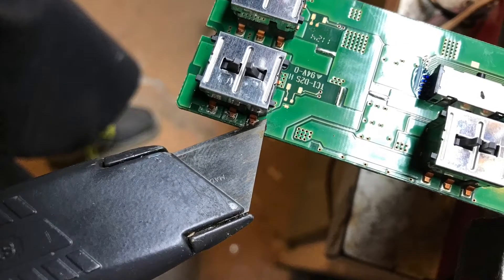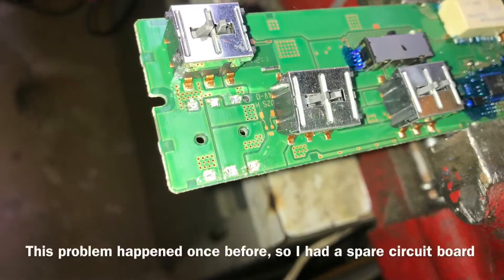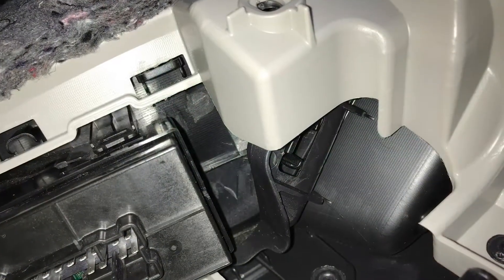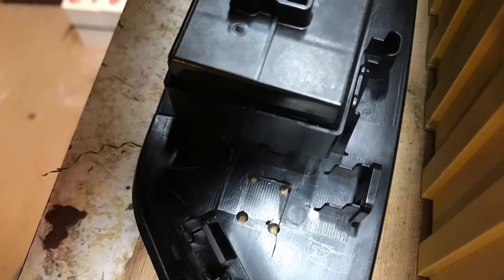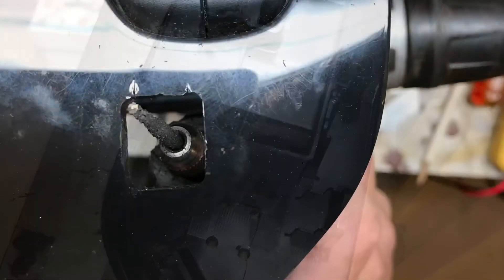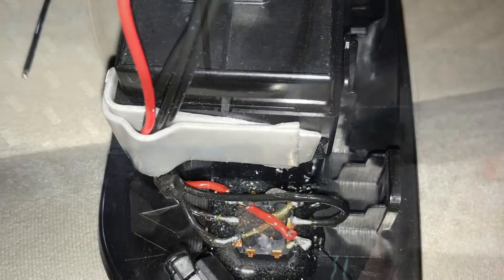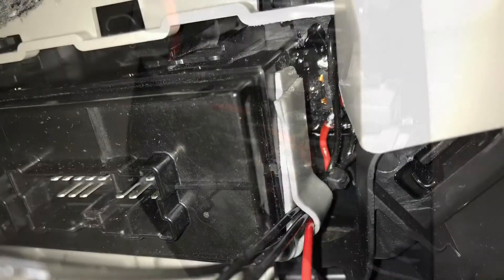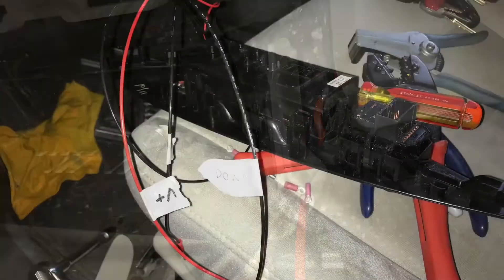I then took my old circuit board and removed one of the switches from the regular doors. I needed to understand where the switch was going to be mounted, and I noticed a spot in the center with bare plastic that would be safe to put the switch. I drilled it out and hogged it out with my Dremel tool, then mounted the switch there with five-minute epoxy and some VHB tape for strain relief. That's the finished product of the door switch assembly.